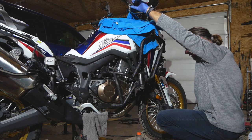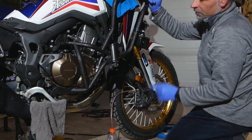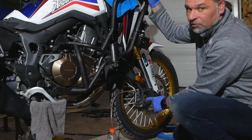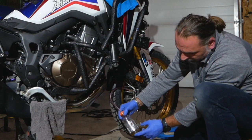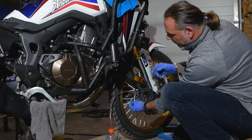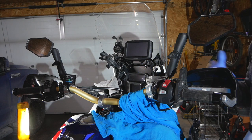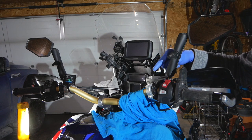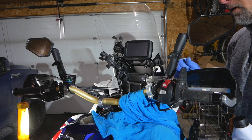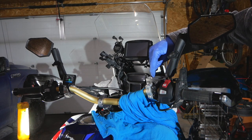Be careful how you open and close that valve — it's quite important not to introduce air into the system. At this point I was able to refill the master cylinder twice, which tells me new brake fluid is already coming through. I collected quite a bit in the catch bottle. I'll tighten that off and move over to the left side, running the same procedure and refilling the master reservoir one more time.